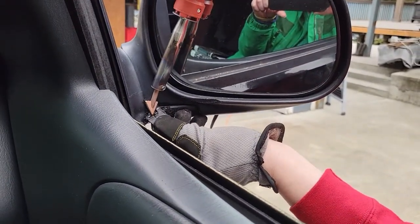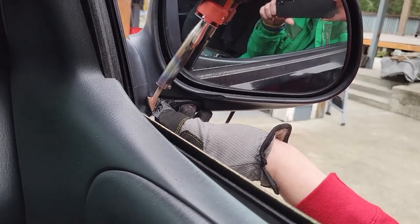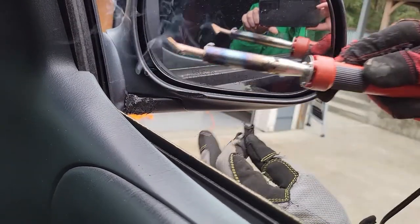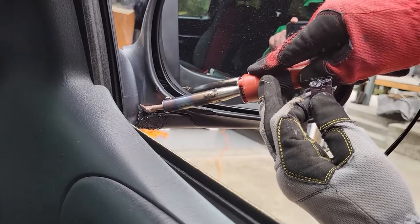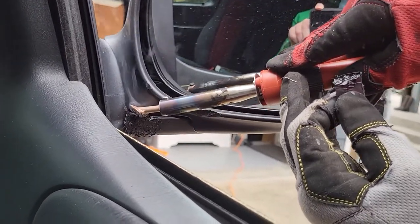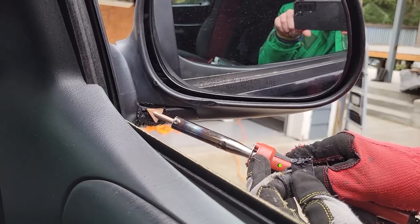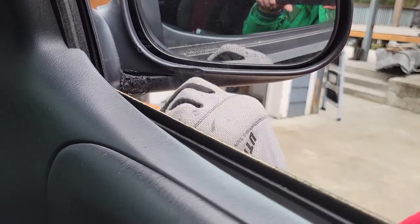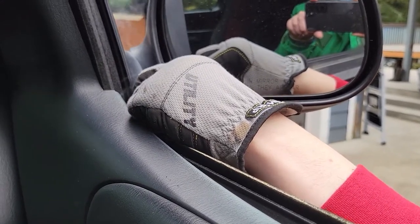It's a really tough angle from this side — it was much easier on the other side. I'm pulling material into the housing and melting it. I want to make sure this can still slide both directions, so I can't go quite high enough — I need to flatten it at the top as well. I can still see a little bit of metal, so I want to still add some more supplemental material. That's basically how we do it, and I'll show you the result after I'm done.